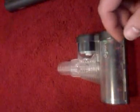Because the turbine is also exposed to all the dirt that's going through, especially gravel, especially the gravel that's in the Dyson right now. And so sometimes it could chip the fan. It will bog down very easily if you put it to load, or if you put it through a lot of gravel, or kind of heavy dirt. What Dyson did, now Dyson, they used to have this design also, with their turbine heads with a DC-07, DC-14. I think by around DC-17, they started introducing a design where you could shut off the turbine head without turning off the vacuum itself. Which is kind of cool, but anyway, they eventually made this design.